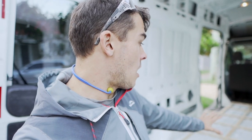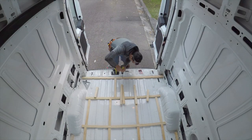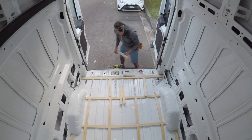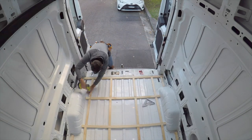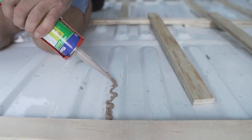I've stripped down some 15mm plywood into 40mm wide pieces — that was the cheapest way I could get strips like that. I've cut them into a pattern and I'll fill it in with insulation after. To screw these down, I'm going to glue them with construction adhesive — it's called Liquid Nails here — and then screw them into the floor with self-drilling metal screws, so they won't vibrate or squeak when the wood rubs against the metal.